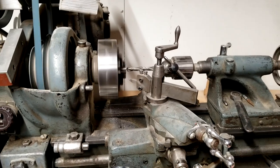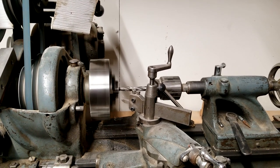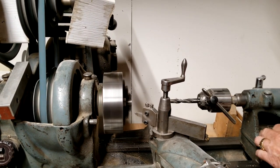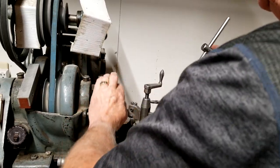So we've measured the bushing, which Jim's taking the bushing right now. He's taking out some of the inside of the bushing because the bushing is too small — about 10 thousandths. So what he's going to do now is he's got the spacer and the bushing. I'll get you a measurement for the bushing. They just had these laying on the counter at Mid-State Bolt and Screw. But you need this bushing in order to be able to use the RAM mount device, the ball holder, and torque down the handlebar when it's done so it's supported properly. These are two things you can get from BMW — I got them locally, and it's serving the exact same purpose.